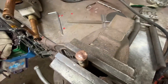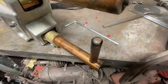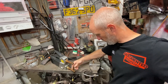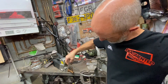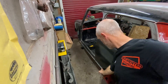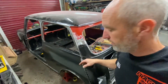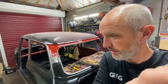That's all cleaned up now — I've had bits of crap all over it, looked dirty. So I'm busy cleaning them down. I'm going to take that one out, file that one down, file it smooth again. Then I'm going to tilt it so the jaws are angled — that one and that one — and it allows us to get in there easier. So that's what I'm doing this morning. Then I'll finish off the spot welds along the sill, take the waist rail off, fit the new waist rail, and that side's complete. Then I'll move on to the other side — wish us luck.